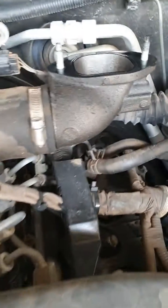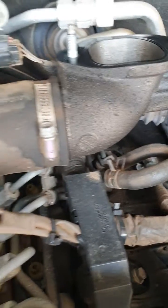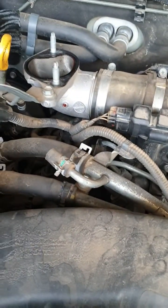We can have a look. It hasn't been sealing properly down here. This side here is all oily and messy because it's coming back out of that passenger turbo. This side over here is as dry as a bone.